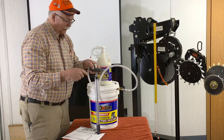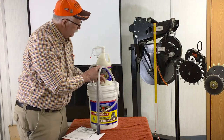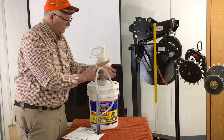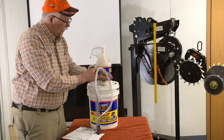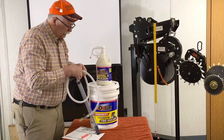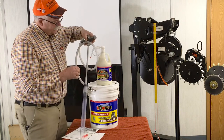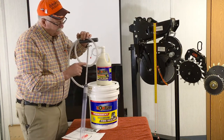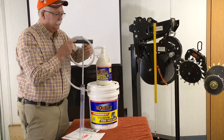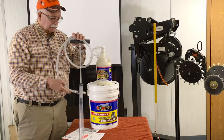The shut-off stops the pressure in the pump and allows you to disconnect from the tire. You get a little squirt of air that blows up any product in the valve stem. You remove the valve core before filling, then put the core back in after you've filled it up. This pump has a 10-ounce metering feature — markings for 2, 4, 6, 8, and 10 ounces. You can set the locking nut; for 45 ounces you'd set it at nine and pump five times.